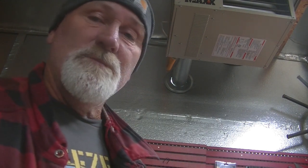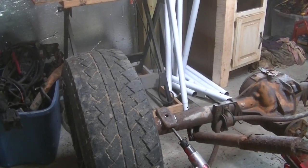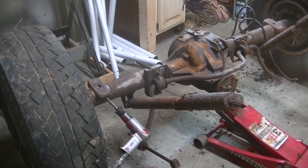We're getting these pads off of the axle — it's a three and a quarter inch axle. What I decided to do since I couldn't get them off — it was taking too long — is take the plasma cutter and cut them off, grind it down flush, repair anything I need to on the axle, and then build some new mounts and put them where they need to be. So I've got to get the plasma cutter set up and start cutting those off.